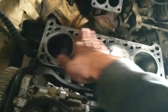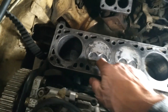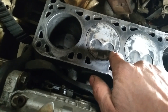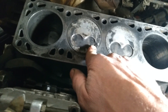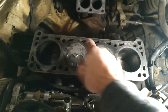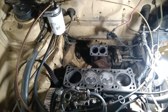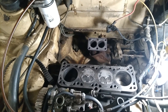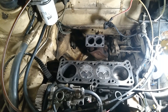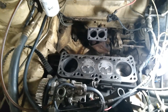The top of the cylinder head looks okay — I cleaned it up with some green scrunchie things and carburetor cleaner, so that cleaned up pretty good. The tops of the pistons: this one in particular has a little nub stuck right there and a little chunk taken out. I don't know if a valve could have hit that. Number one cylinder has a little divot in it also. After I measure the bores, I'll go ahead and order some pistons and new rings. That means I'm going to have to drop the oil pan so I can get to the bottom of the connecting rods and push the pistons up through the top to swap them out. Hopefully the connecting rod main bearings and the crankshaft journals will be okay and I can just reuse all that stuff.